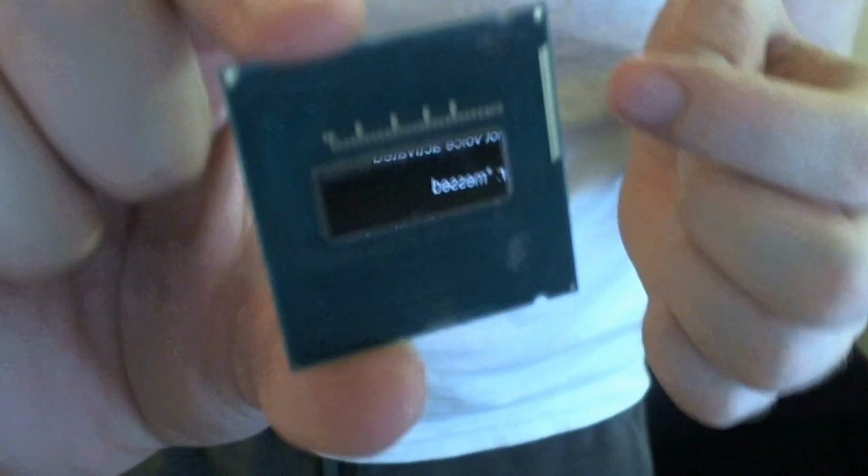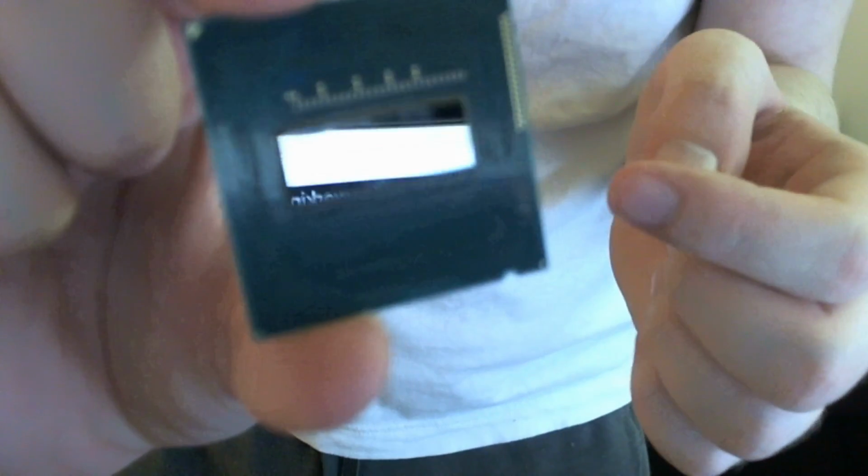And then we compare that to our chip, where we removed all of the black, nasty stuff, and the die itself is very clear. We can almost read the computer screen, the reflection, right? For the most part, you can still see an outline of where the black gunk was, but it's gone. As long as it's not sticking up out of the thing, it's okay if there's a little outline left there.